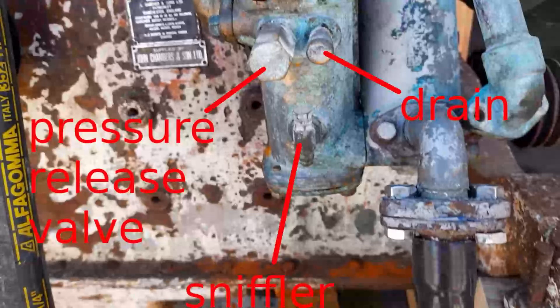There are a number of widgets on the outside of the pump. We've got a high pressure release valve, and this is really important because on Gardner oil pumps I have experienced the pressure growing so high that it has actually burst the pressure gauge. So it's important that there's some kind of safety release there, and that's what that pressure release valve does.